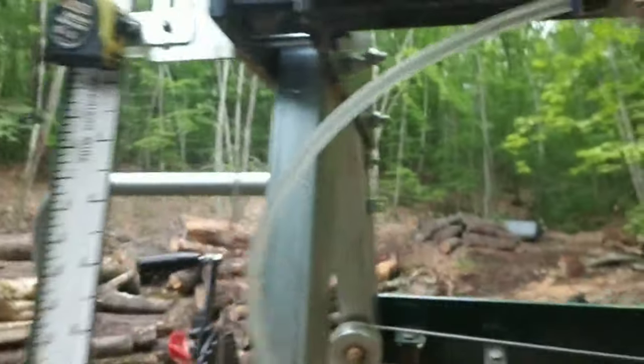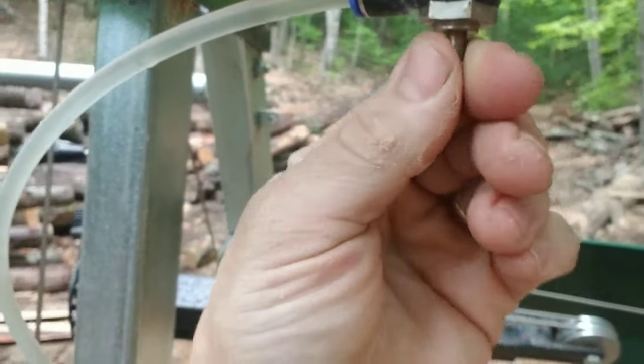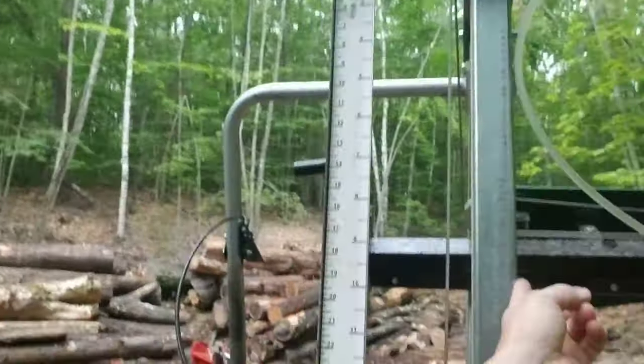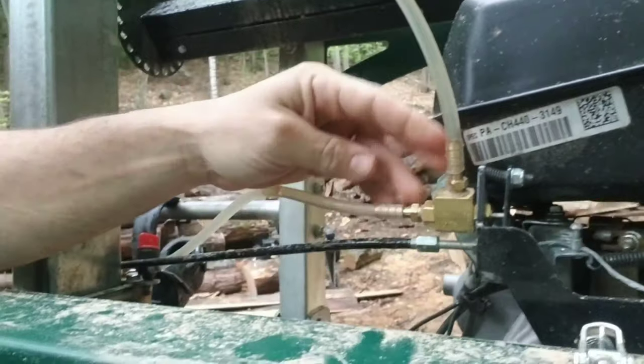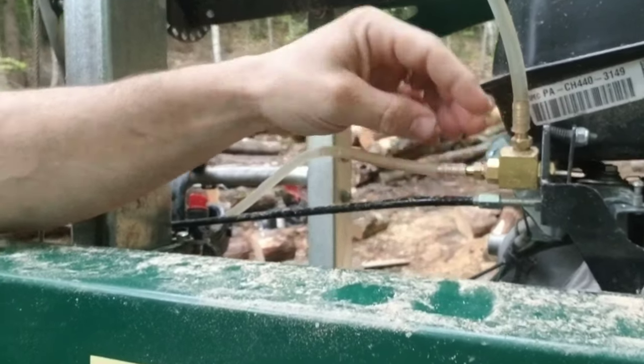The issue I had with mine — which you probably won't have — is that eventually the nuts on the valve fell off, and no matter what I did it was broken internally. The valve wore out from me turning it on a regular basis, probably because my other valve wasn't working so I was using that as the on/off, which you're really not supposed to do. I replaced it with a fuel shutoff valve to regulate flow. What this new auto lube valve does is bypass the original valve; you run the lines over to here, and when you hit the throttle it opens that valve and allows the lube to come right down.